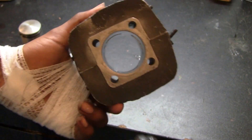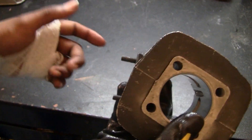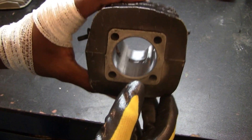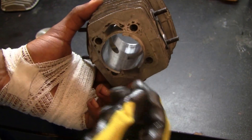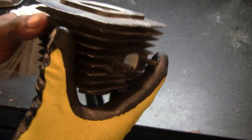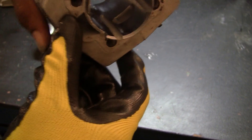It's really unfortunate, but using the standard cylinders you can buy, you cannot bore these out — you end up destroying them. The chrome on the inside begins to chip. However, what you can do instead is use what are called boost ports — something the CAG pocket bike engines also use.